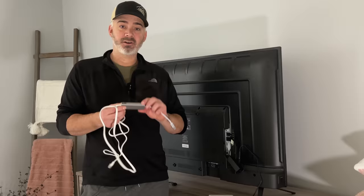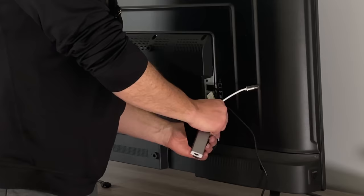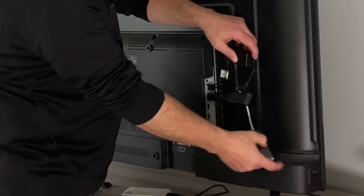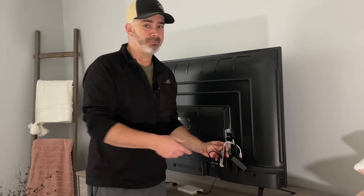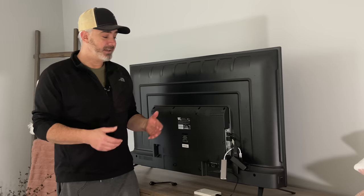If you don't want to use the powered cord setup and prefer a wall outlet, there's a hub that already has a splitter built in. For this setup, you just need a regular USB hub. All you do is unplug the hard drive from that USB port, then plug the hub in where the hard drive was. Now you've got your powered cord, OTG adapter, and USB hub connected to your Fire TV Stick. Plug the hard drive into one of the hub's USB ports — you'll still have two extras for a mouse, keyboard, or gyropad remote.